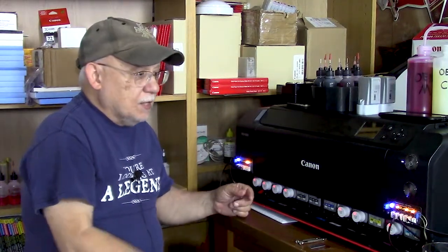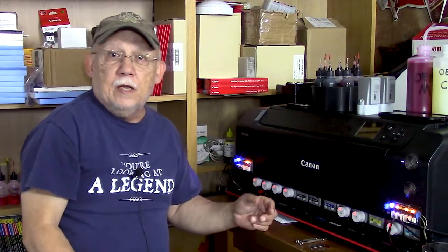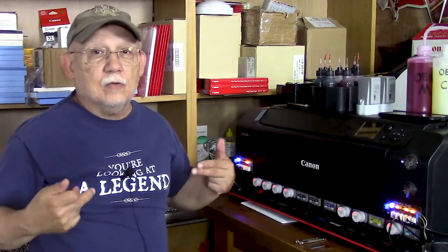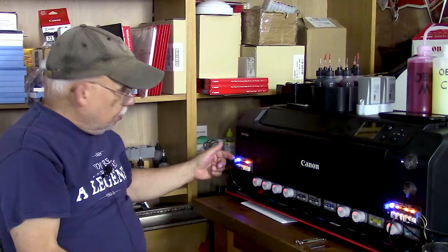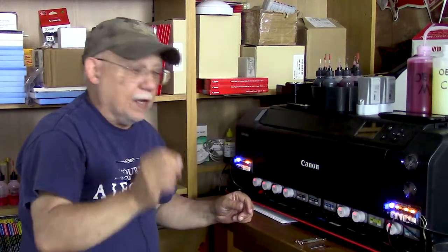Then I realized I actually have to wind it around from here, out here, and then under the lid. I mentioned that didn't seem like enough wire. Mike asked how I'd connected it and I said to the inner — he said no, to the outer ones. So make sure you connect your boards to the far left connector on the left board and the far right connector on the right board. The wires are slightly different lengths, which gives you that extra bit of loop you need to insert into the upper and lower — giving you a nice even bend, as you can see right here. That's why they're slightly different lengths, and yes, it was planned that way.